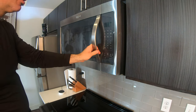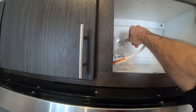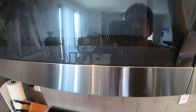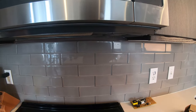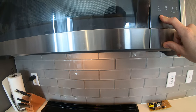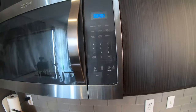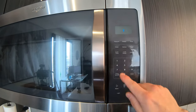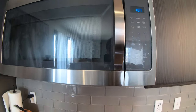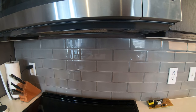Make sure the door shuts, everything looks nice and even. Power it up — and you can see our light is now off. We are powered up and the light is off. Let's test it: light on full, half power, off — working like a charm. Go ahead and set the time, and that's how you replace a control board on a Whirlpool microwave.